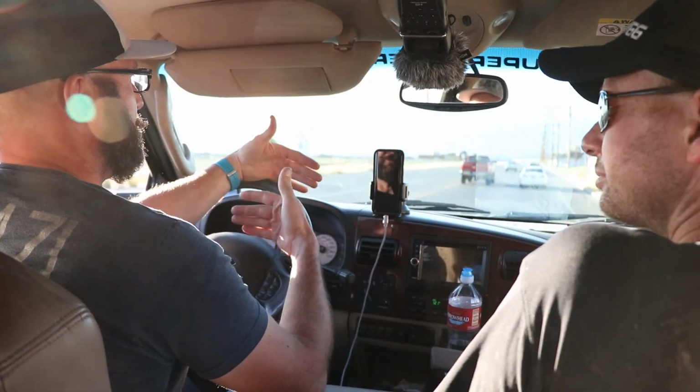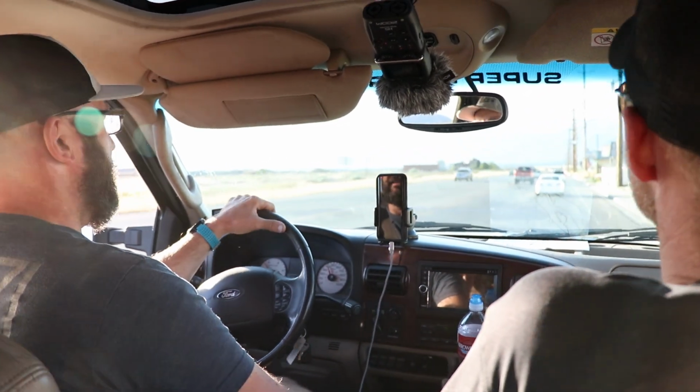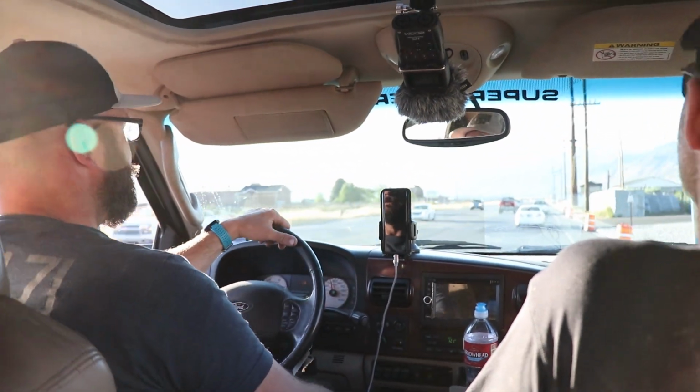No vibrations. So how'd you do the drive shaft? Had a drive shaft shop build me one that was 36 inches long. So it's got a carrier bearing. Originally a two-piece, yeah. Original OEM was a two-piece, but the front shaft was short. Okay. So I just had them lengthen the front shaft, and so my angles are all pretty well the same. But it's lifted too. It is lifted. So I did lower where the carrier bearing is, but because of the extra length on the shaft, it ends up with the original angles. Right. Yeah, because there's nothing.